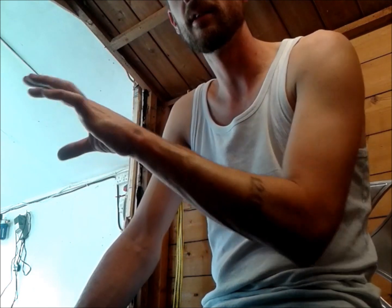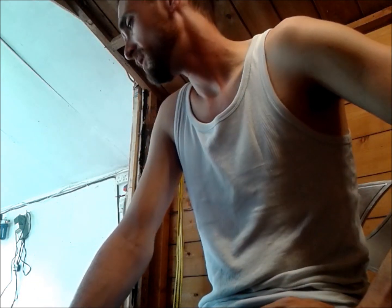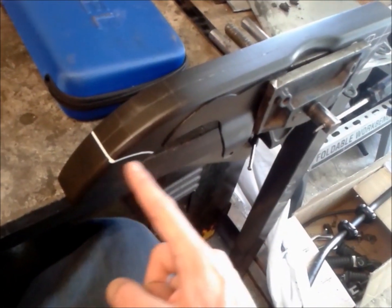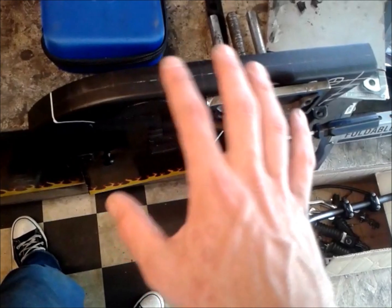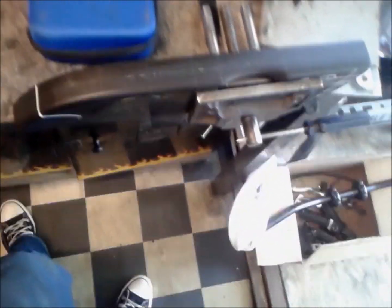First order of the day is working on the old side mount. Actually, just realised I don't really want to get too ahead of myself fabbing up the side mount, because I haven't got the frame to bounce it off. I don't want to start drilling and cutting and then mount it up and realise it doesn't fit. So I'll hold on to that for a while. I am going to finish up Jen's chain guard - chop a bit of the length off, to that shape, and I've marked out where I'm going to put some 20mm holes on the top. I've already chopped off those tabs and given it one quick coat of black - I just find it easier to see what's going to happen on that rather than bare metal.